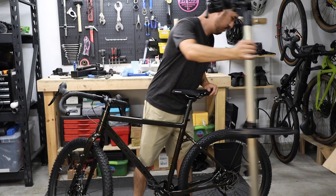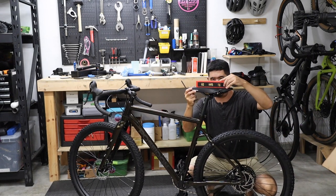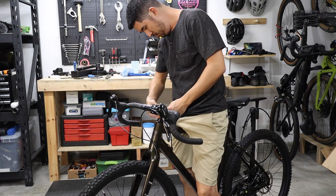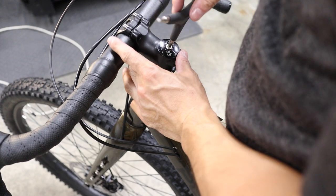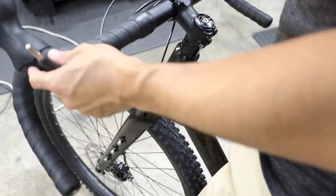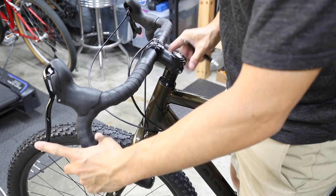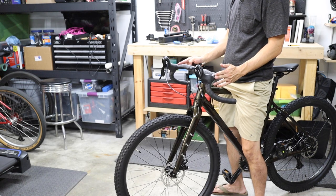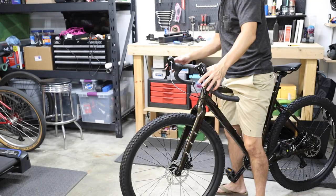With the bike on the ground, we'll start to make some final adjustments. You can adjust the seat angle and fore-aft position by loosening the single 6mm bolt underneath the saddle. A good starting point would be a flat saddle about midway between the two endpoints. When you're finished, make sure to torque the saddle bolt down tight. The headsets on the Redwoods come a little bit tight from the factory, so it's a good idea to adjust them before you set off. To do this, loosen the two 4mm stem pinch bolts, then loosen the top cap bolt with a 5mm Allen wrench until the handlebars can spin freely with little to no resistance. Then tighten the top cap back down by another eighth of a turn or even a little bit less, just to eliminate any play in the headset. Once you have the preload set, make sure the handlebars are straight with respect to the front wheel, and tighten down the stem bolts, alternating bolts by half a turn or so until they're both equally tight.